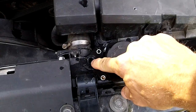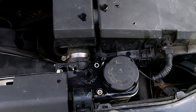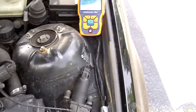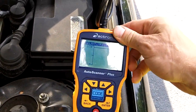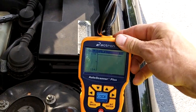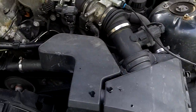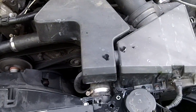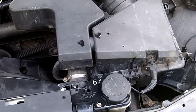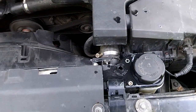For the most part, I wouldn't take this thing the whole way out — I just wanted to show you the water coming out. We can look at our temperature gauge here; it's at about 172°F. The thermostat doesn't open until 200-and-some degrees, and the fan probably won't turn on until 200-and-some degrees, but usually we'll get the system bled before that happens.